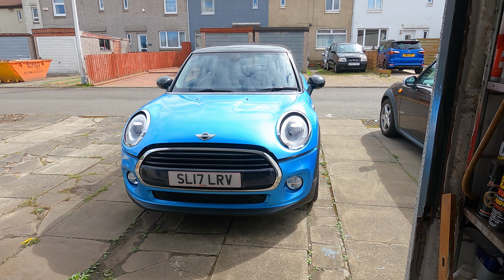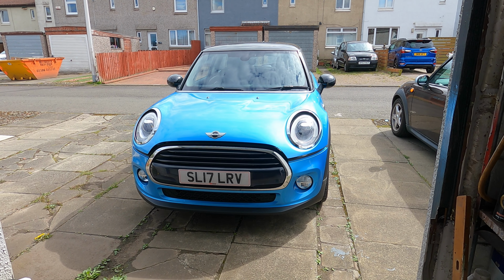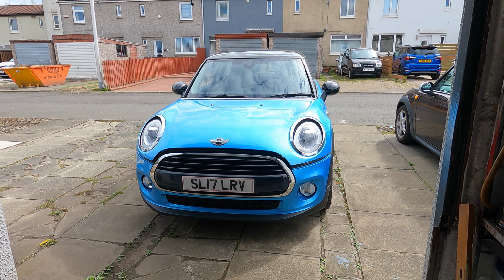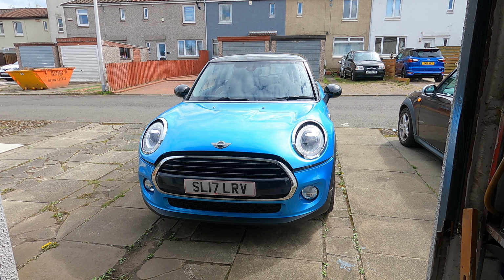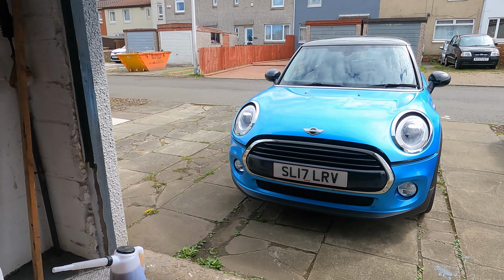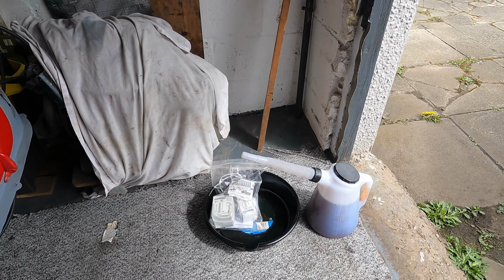In today's video, I'm going to change the oil and filter on my 2017 third generation Mini Cooper D. This is a 1.5 diesel engine, and it takes 4.3 litres of oil according to the Haynes manual. I've already looked out the oil and measured out roughly 4.3 litres.